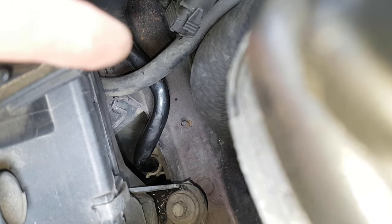Righty-ho. I've got the socket on the tensioner. And you can see what sort of space you've got around. You've got the compressor, the pipework from the compressor one side, and something else the other side. Put the light on, I think. Right, gone for a slight change here. I've gone for a shallow 19mm socket, followed by a universal joint, and that seems to be a lot better.